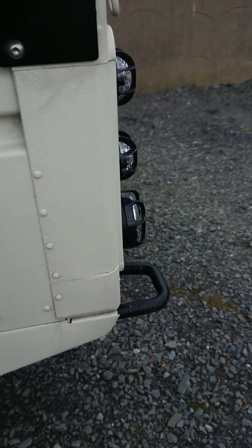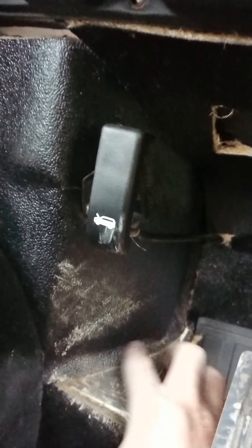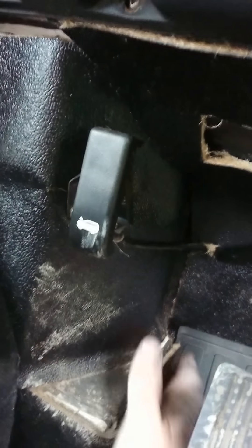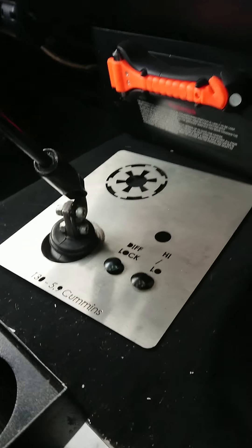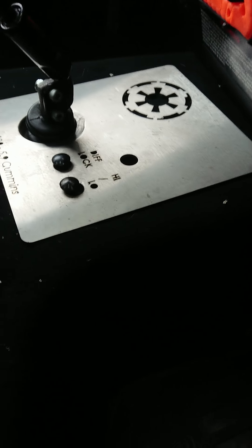Basically, in and around the driver side footwell — this is the cutout that needed to be made down here. It's basically a wee notch — a triangular piece with two flat pieces. Dead straightforward to make, not too difficult. Once that's done you have to make your own transmission tunnel. I basically made mine out of one of the plastic R380 tunnels, cut it in half, widened it by about 100mm, and refitted it.